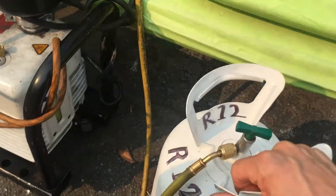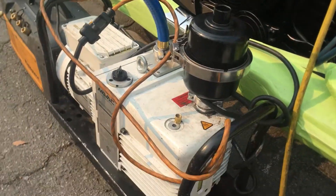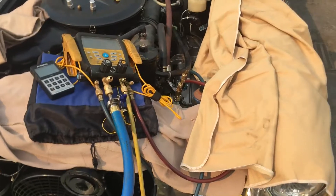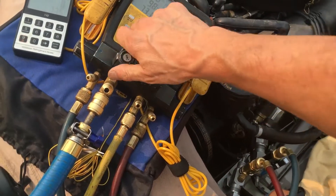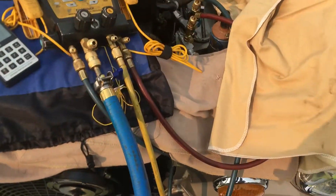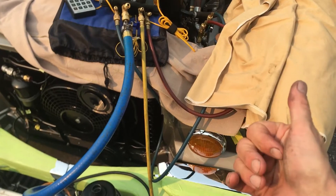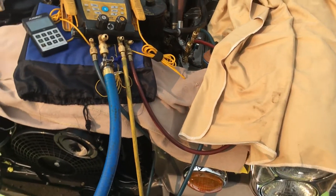There ain't nothing exact happening here. The only thing I went out of my way for is the nitrogen purging and extremely long vacuum times — took down a really good long vacuum to dry out the system, because you've got a $450,000 car here. Let's make it work right the first time. I went beyond NBF to make sure there were no vacuum leaks, no pressure leaks. And that's it. I'm gonna kill the camera now — there'll be another video. I'll see if I can get this started and run some temperatures and pressures.